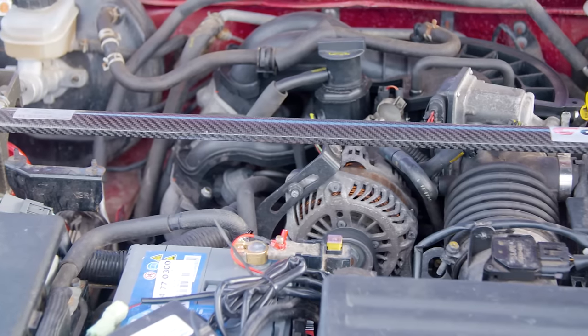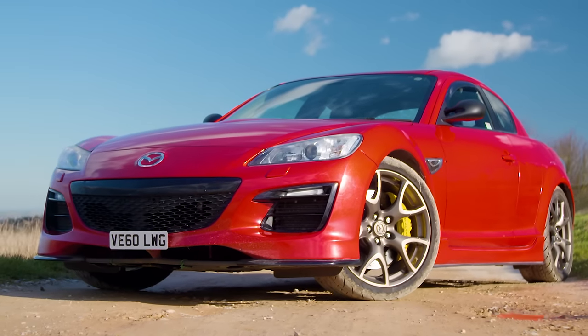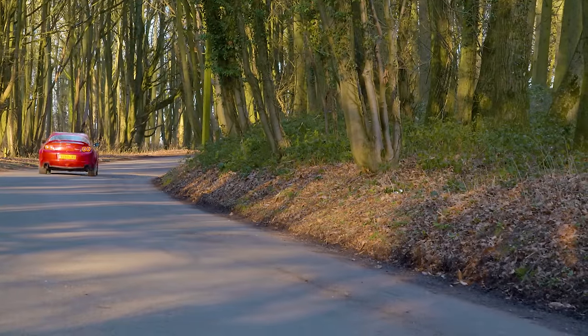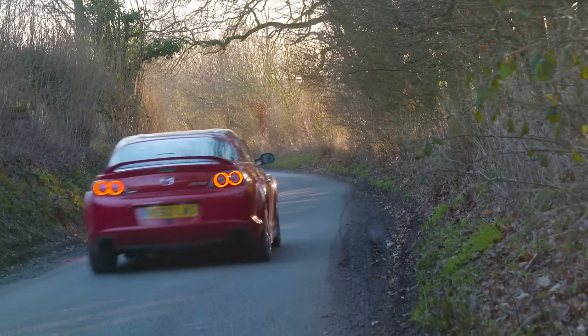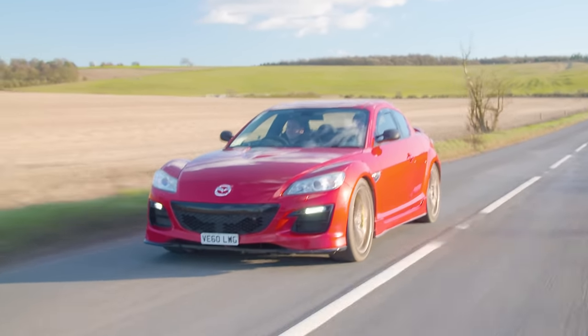The braps are the result of a bridge-ported engine's eyebrows, which open a few degrees before the exhaust ports fully close, causing an intake and exhaust overlap. This is the first time I'm ever going to drive a bridge port — let alone a bridge port with everything lightened. Wow, that already feels so much smoother. This is running a Racing Beat three-inch header, the jawbreaker resonator, and the same cat-back that's on Felix. Wow, that was 10,000 rpm! It's just so much smoother — and because everything's lightened it picks up more quickly. Felix takes a little longer to get above 5,000 rpm; this is more willing.